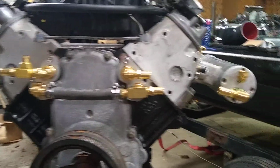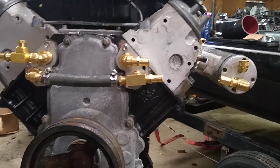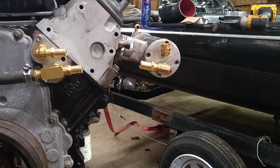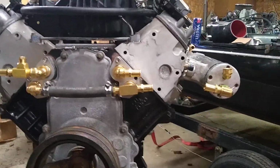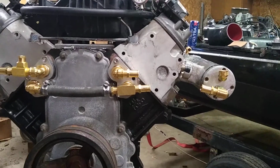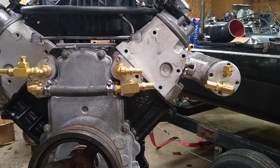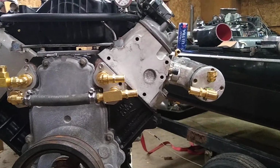My problem with that is, the other boat, the blue boat, was originally plumbed where it went right into the engine, and then into the manifolds afterwards. It has very similar manifolds, just like these. The only problem I have with setting it up like that is I'm plugging the thing up with weeds all the time, pretty often. Chances are with this boat, I'm going to be doing that even more often. We're trying to send this thing into places you probably really shouldn't go with a jet boat.